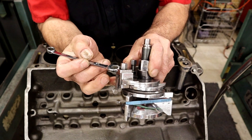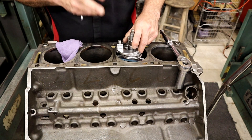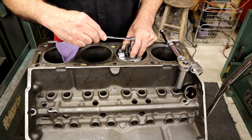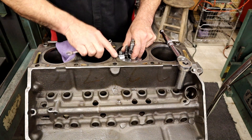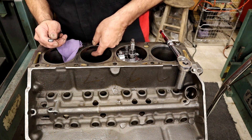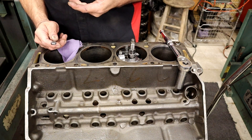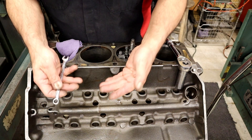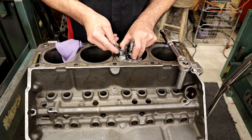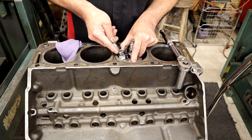When I'm talking about the top flush, I'm talking about just the top of this piece right here — not the top of the bolt, but the top of this aluminum piece. Once you cut one, you're going to know what I'm talking about. Sometimes I need to lower it because the ridge is further down — for example, Chryslers don't come up in the hole very far, they're 70 thousandths down. It's a different animal; lower your tool.